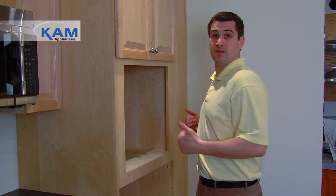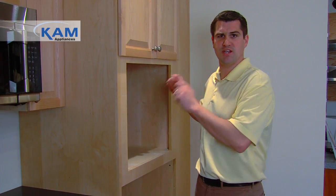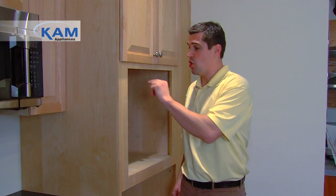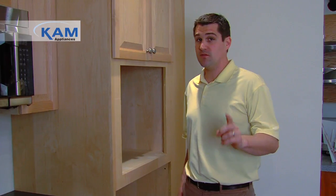If you're in the market for a new built-in wall oven, size and the availability of space is very important. Today's wall ovens are larger, so if you have an older wall oven, you want to give yourself as many opportunities to buy a new product as possible. When taking that measurement, unscrew the wall oven and sneak it out a couple inches so you can get a tape measure back there. Pay attention to how much more space you have in the cabinet — could you cut the cabinet opening wider? Because if you can, you'll have a lot more options when you come in.